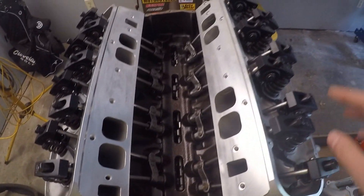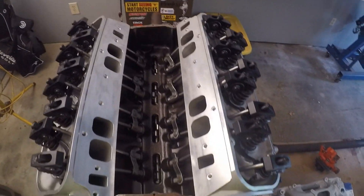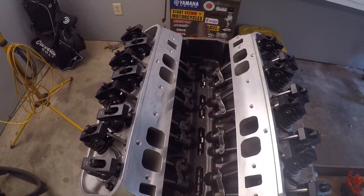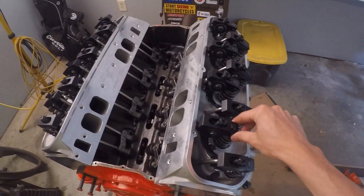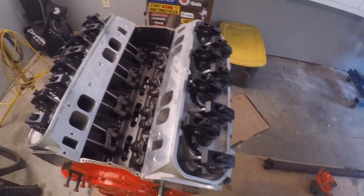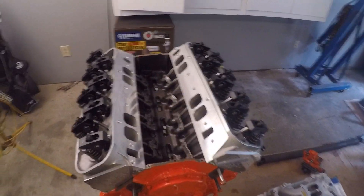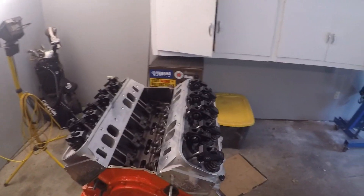That's the same with all of them — for cylinder two, you're going to watch cylinder two's exhaust and then adjust the intake when it just starts to open. Usually what I do is go through and adjust all the intakes, then come back and do all the exhausts, then spin the motor over a couple times and check all your lash in a few different spots to make sure your adjustment went right. You'd really have to mess this process up pretty bad to hang a valve open and have a piston hit it. There's even a write-up on Comp Cams' website about this.